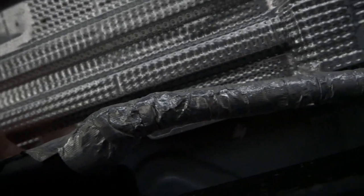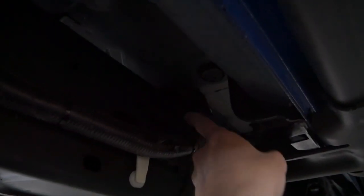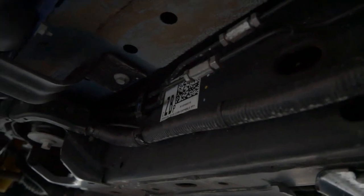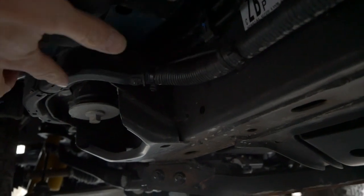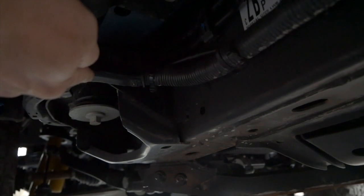I came back from the tail light over the top of the axle following the frame line. It'll connect over the top where the trailing arm is on the top of the frame — there's a wiring harness there. Then as soon as it comes up over the axle it'll disappear on the underside of the frame, right on the back side of the frame here. I just followed that all the way along around where the body mount is. This shroud right here is actually an electrical shroud that goes around the body mount, so I just went on the top of it, and around on the back side it'll actually go right up into the engine bay.